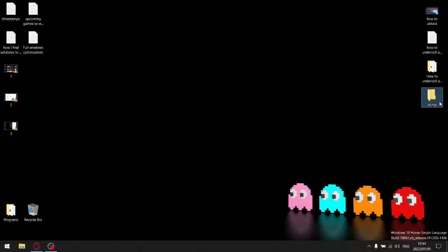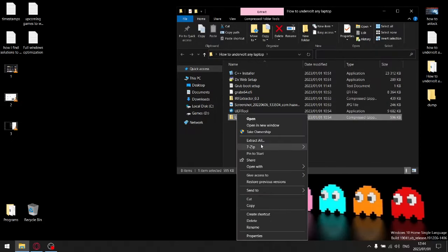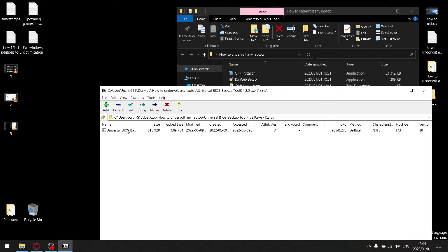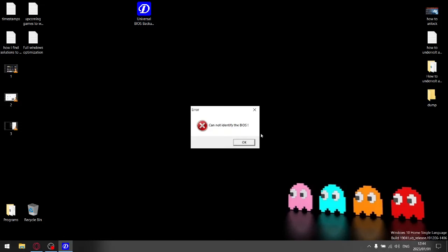Okay, drag this underneath that folder where you've downloaded all those files to. Just open that up, extract the Universal BIOS Backup Toolkit to the desktop. Close this off. All right, and then what you're gonna do is run as administrator.